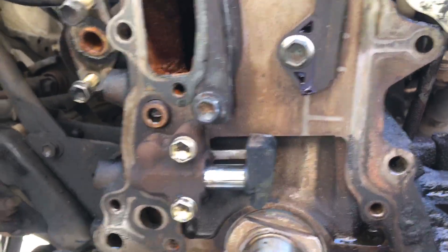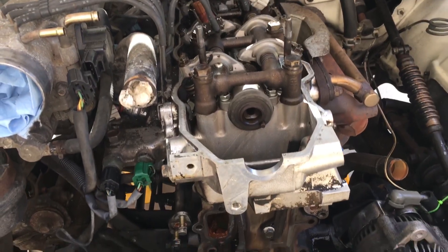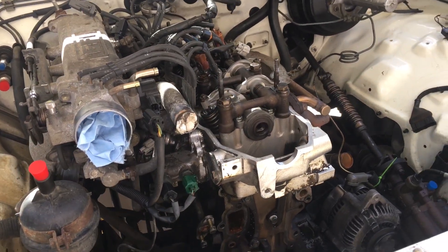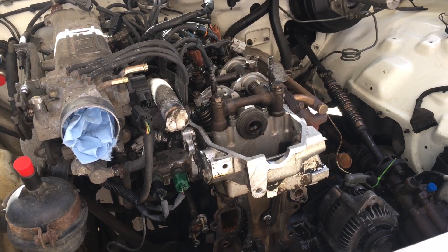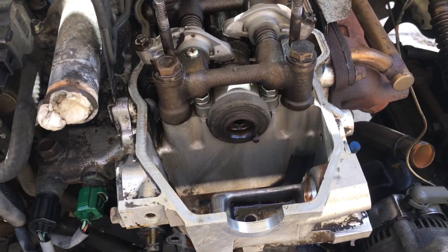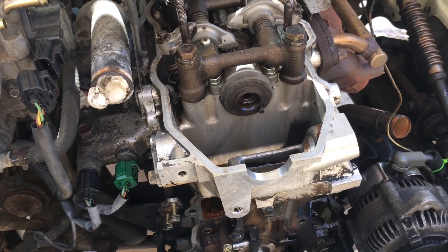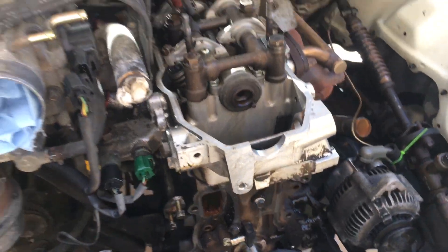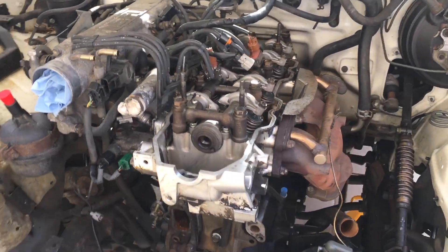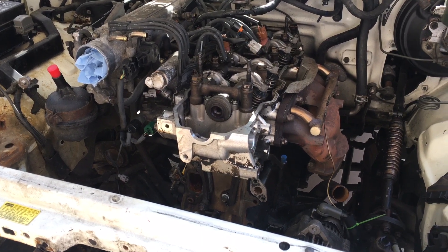So depending on whether you have oil going into the coolant or coolant going into the oil, that can give you an indication of where the problem lies. Here is that little hole that develops when your timing chain gets too loose, your tensioners break, or you push the tensioner to its outer limit. I hope this gives you a firsthand glimpse of this bizarre thing that can happen on the 22RE. If you ever run across a motor with water in the oil, it may not be a cracked block or blown head gasket — it might just be that no one ever changed the timing chain. On these single-row setups, after a couple hundred thousand miles they start slapping and cutting into the aluminum. Thanks for watching!